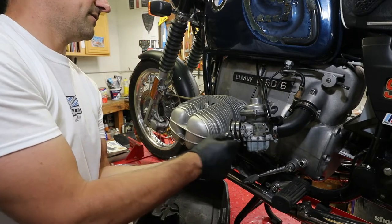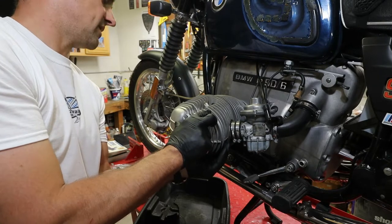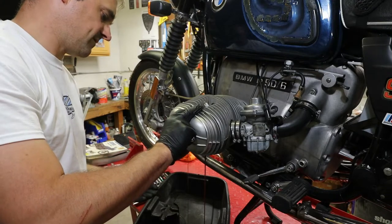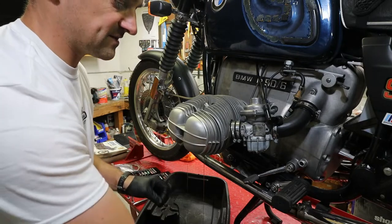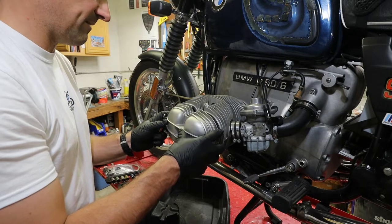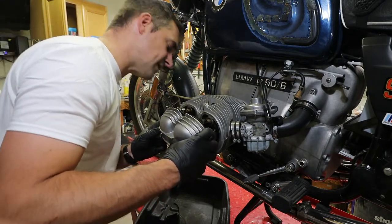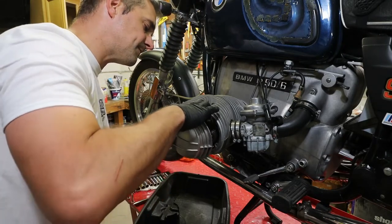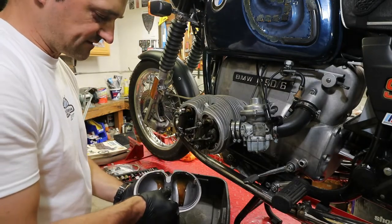And there's supposed to be a washer. Some people put a flat washer and a wave washer. I usually just have a wave washer behind there. Oh, here's the oil. Here's my wave washer. I always replace those wave washers, stainless steel. They give some tension, but usually they bend flat. Oh, there are actually two washers behind there, a flat and a wave. Didn't even remember that. So, valve covers, the gaskets can be reused.